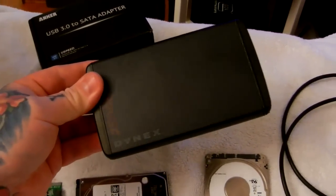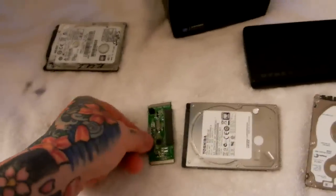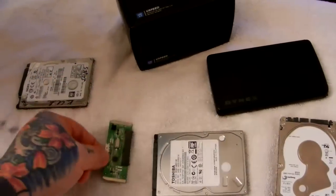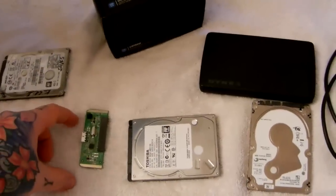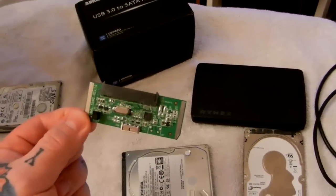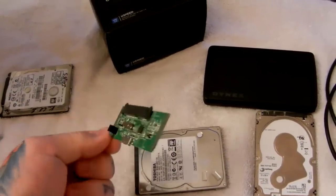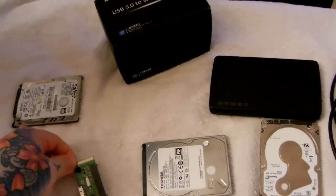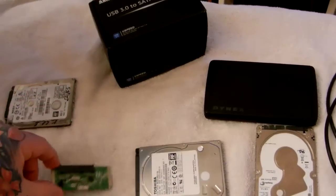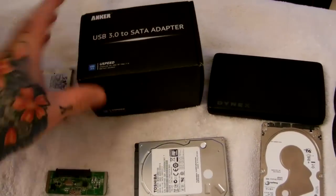Here's a dead one. Inside is just this little card inside an aluminum box. All you're paying for when you buy an external USB hard drive enclosure is a USB cable, this aluminum box, and a little SATA card inside — these are junk. Now the actual hard drive manufacturers have good reliable ones of these, but it's impossible to buy just this piece reliably and cheaply. This is literally a 50-cent part but you unfortunately have to pay $20 or $25 on eBay to get one.